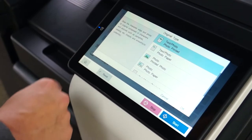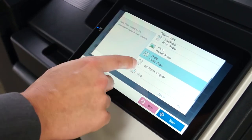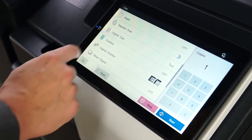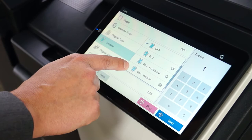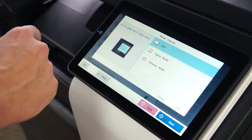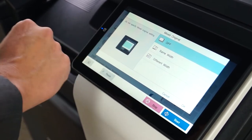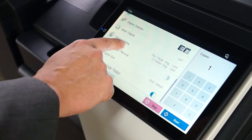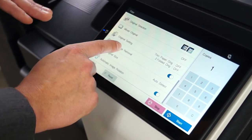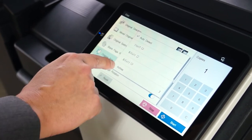Original type — text, photo, or photo printed — is the default. You should get clear images with photo printed, photo, or dot matrix, but personally the difference is hard to see, so this is really up to you. Combine: if you want to combine multiple pages into one, you do that here. Mixed originals: select this if you're scanning sheets of different lengths but the same width, or different widths but the same length. Blank page removal: if turned on, any blank pages on the back of a one-sided sheet will be removed. Original size auto-detect: you can manually select the paper size you're copying if needed.